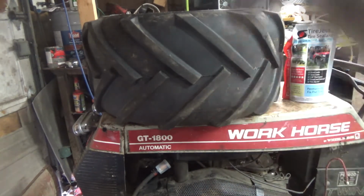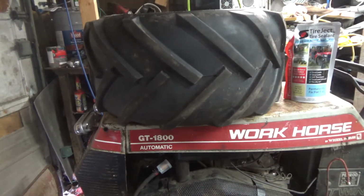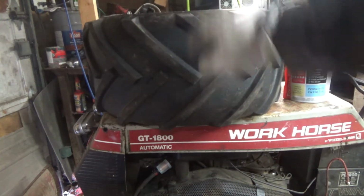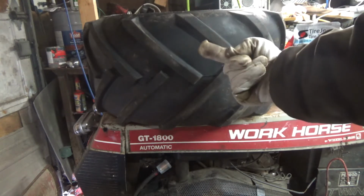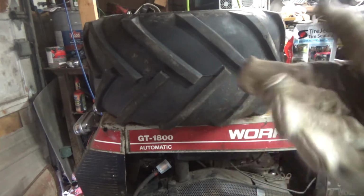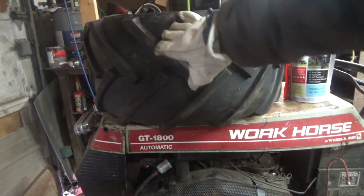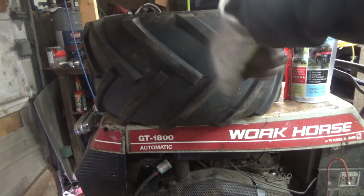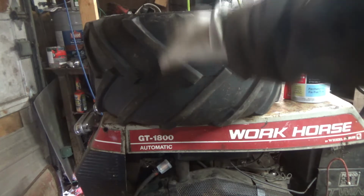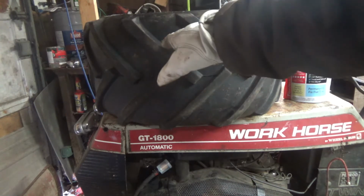That tire had one. That's why you see me jab a pick through the tire to get the sealant out. That sealant has to come out of the wall, out of the tread. If there's a hole right here, the sealant has to leak out, and if it doesn't leak out, it's not going to seal, because it cures in the air. And if you put water on here like I was doing on that tire, the water is just rinsing off the cleaner or the chemical. So do not use water. Make sure there's a physical hole where that leak can leak out.